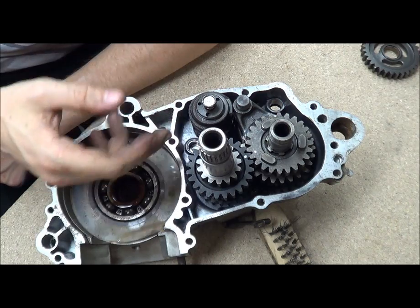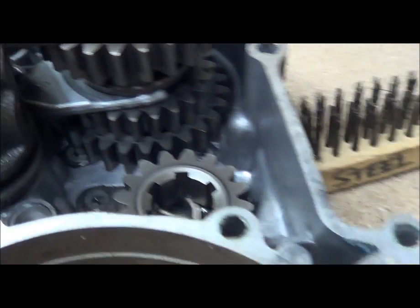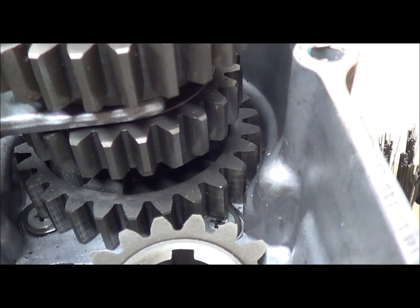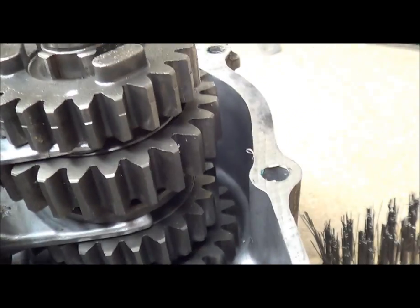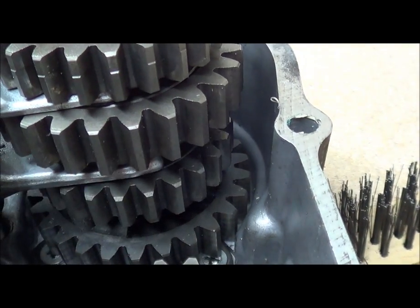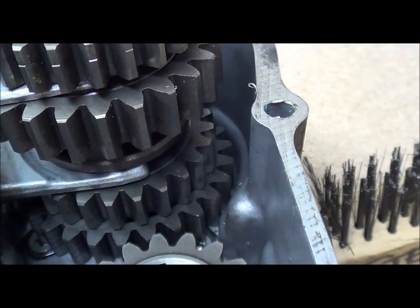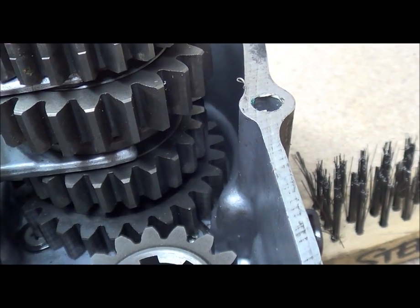So whatever the shaft rotates we'll see it here, and because this is a free-wheeling gear it'll just follow what this one is telling it. I've just removed the input shaft to show you - you can see as you turn this, you can see in there where the dog should go in this bottom gear, and you can see how the gears move. That's how it lifts out, so you've got quite a bit of movement there. If you go the other way that's now moving the top gear which will lock into the gear at the top. That middle position there - that's this gear in the middle not locking the bottom one or the top one, that's the neutral station position, not engaged either side.